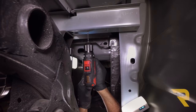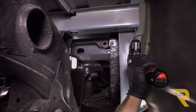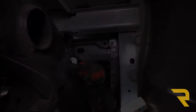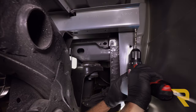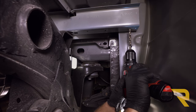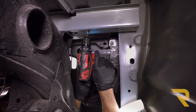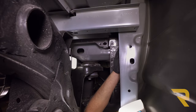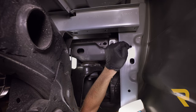First let's go ahead and drill a couple of pilot holes. Then we're going to set the compressor in place using the provided hardware — start the first hole, get that attached, go up to the second hole, get that attached, then put in our self-tapping bolt and tighten up the hardware.